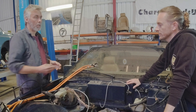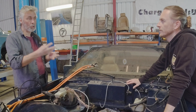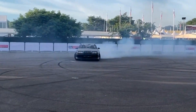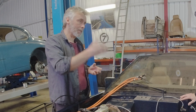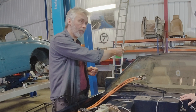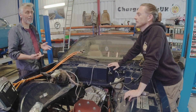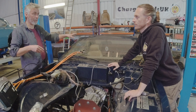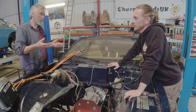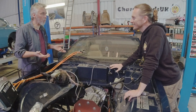What we want to do is directly drive your differential. First problem is the Tesla unit has got a differential in it already, so we'd have to lock that up — take it apart and weld it up to stop it spinning. But the gear ratio is completely wrong, because that Tesla unit is designed to go around at a speed that matches your wheel speed directly. Here we're going through your differential which drops the speed by three and a half times before going to the wheels. So if we directly drove that rear axle with a Tesla unit with a welded-up diff, we'd be going three times slower — the acceleration would be amazing but the max speed would be about 40 miles an hour.